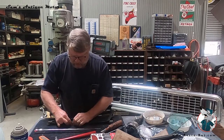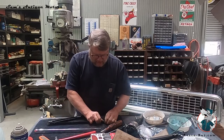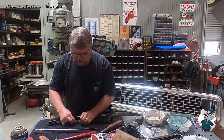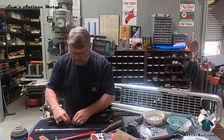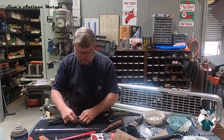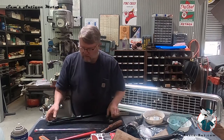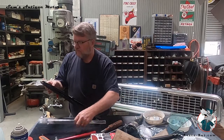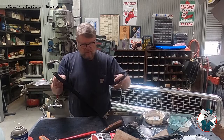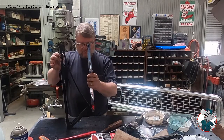And it's got a metal backing in it, so you've got to take that metal backing and straighten that out nicely so that the rivets hold it up onto the metal tight. I actually put just a little hump where each one of the rivets are, so the rivets will pull down and make it tight. So now we've got that all positioned.